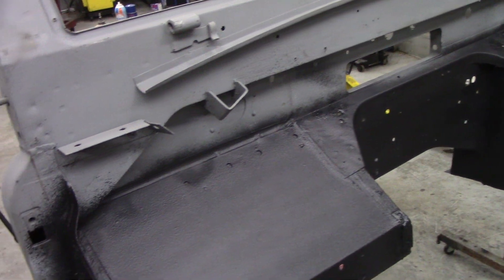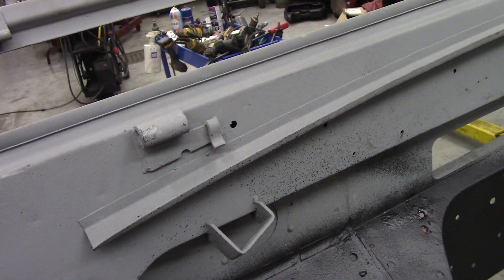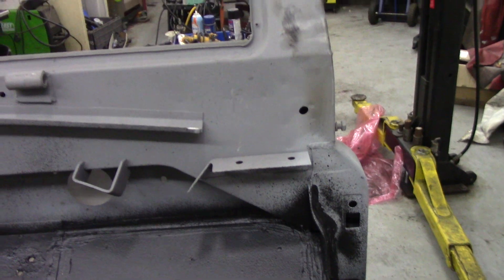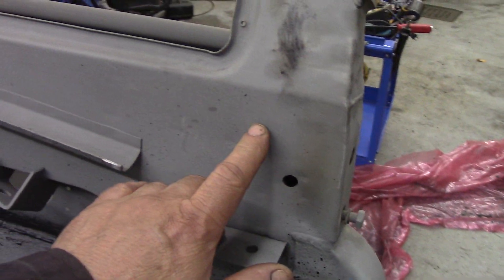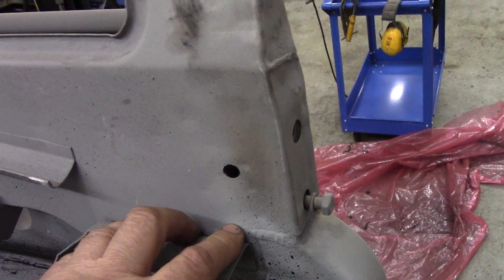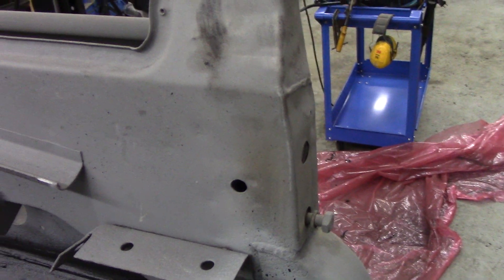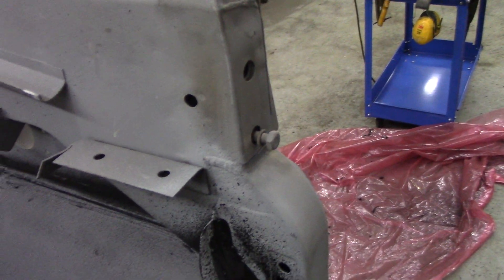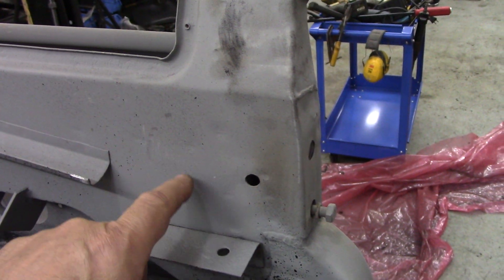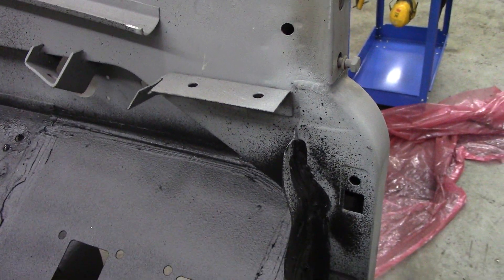It's nice and solid, it won't leak. Once it's painted it wants rust proofing. That tab needs bending up — that's the bonnet stopper, which shows it's a Series 2. This piece is very strong — it's laminated. This is why they rust out: humidity and condensation, the water runs down, gets between the laminates, and busts everything out. I suggest putting warm fluid film in and filling all of this up, letting it drip out into a bucket so you can reuse it. Then it'll be good for a long, long time.